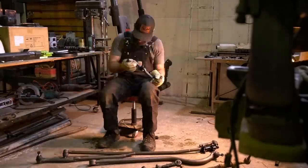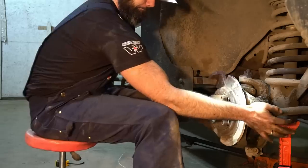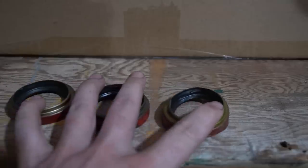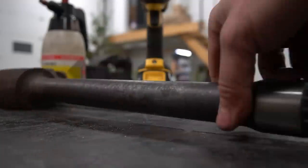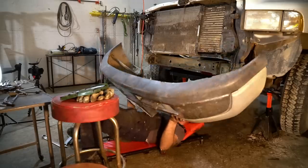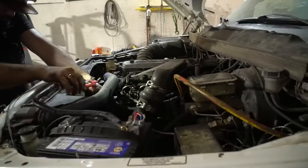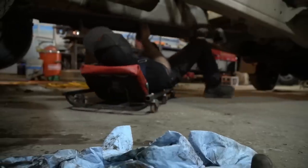All of the steering components are relatively easy — they're just bolt-on parts — but the front axle was a bit of a challenge for me, not necessarily in the work but in sourcing the correct parts. I got the axle shafts machined back to a perfect surface, new seals, new hubs, new u-joints and brakes, and then reassembled. It's not completely necessary to take the front clip off to do either of these jobs, but if you have the time it makes things way easier.